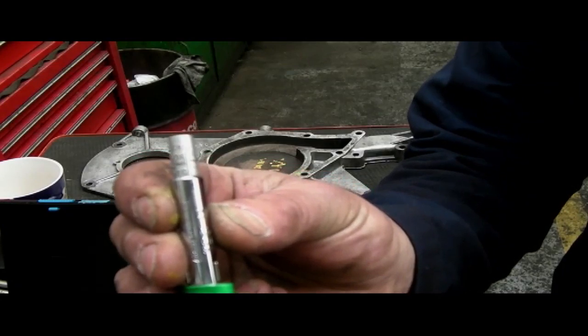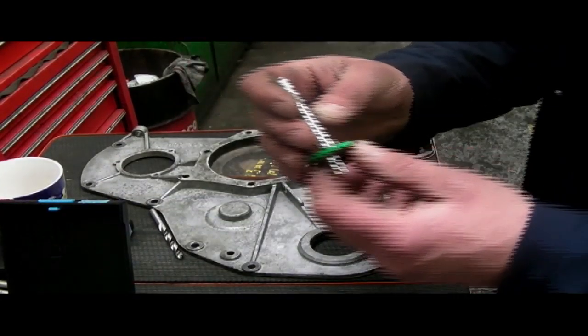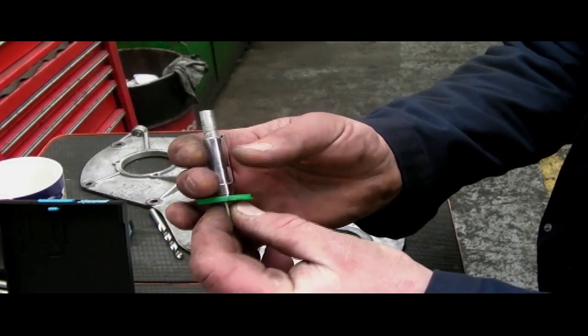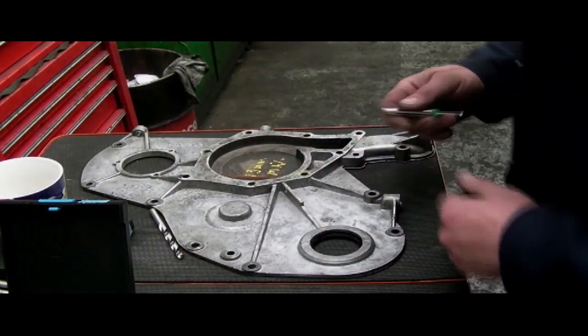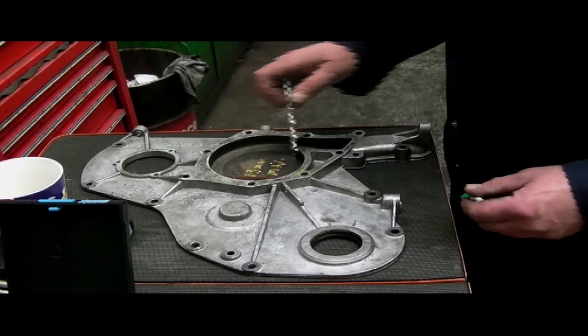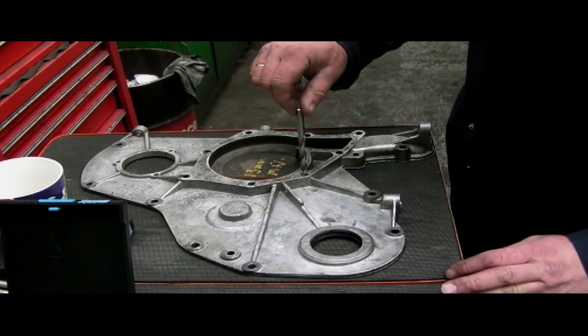So I'll be drilling to about 17mm or 18mm. The rest are actually quite deep — this one is about 17mm as far as I'm aware, and the others are 19mm. I've got the drill here and I'm going to drill out this hole so I can then tap it.